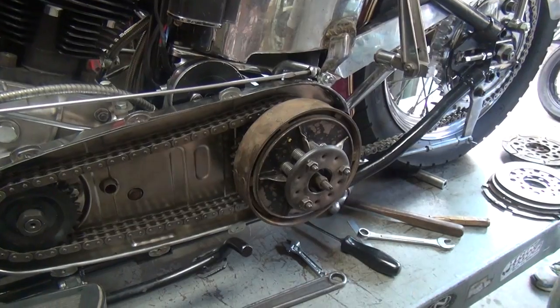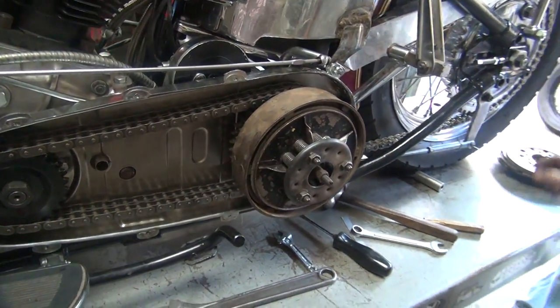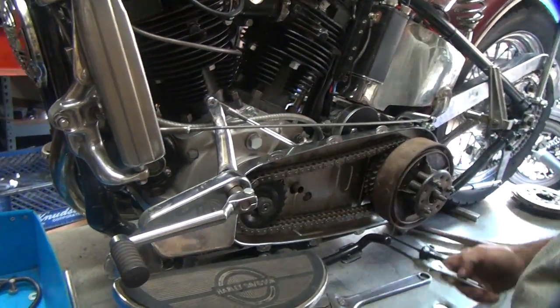You always want to make sure you got clearance here because if you run out of clearance, your clutches will all start slipping because they'll be half released on you. So we got our chain there. Now as you adjust this primary chain, you'll have to come back and do this. All you got to remember is you have about an eighth inch of free play here. You can run it twice that if you want — but that's a good starting point. You've got to fine tune it for how you want to ride the bike. So this screw sticks out pretty far, but as long as it clears our derby cover — for now, we're done with that.